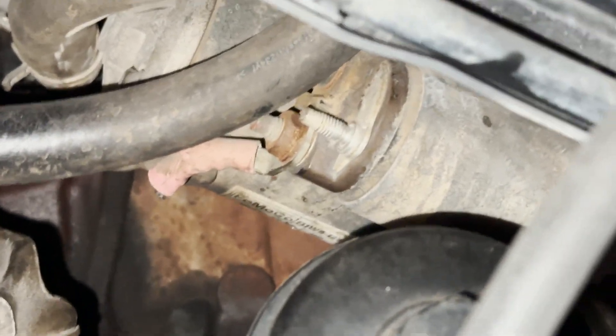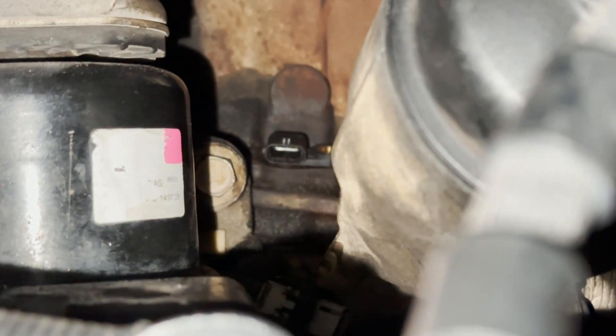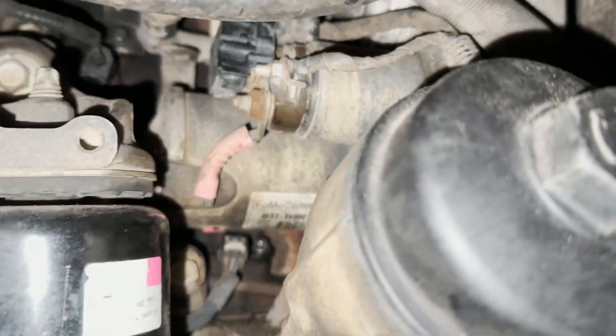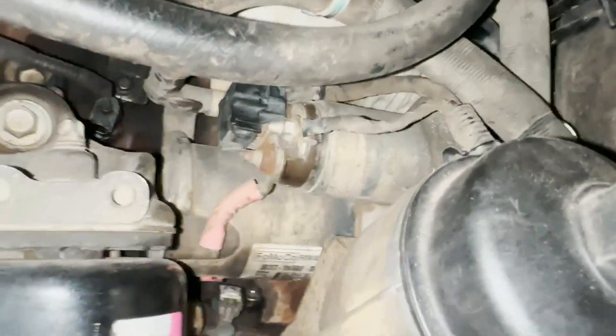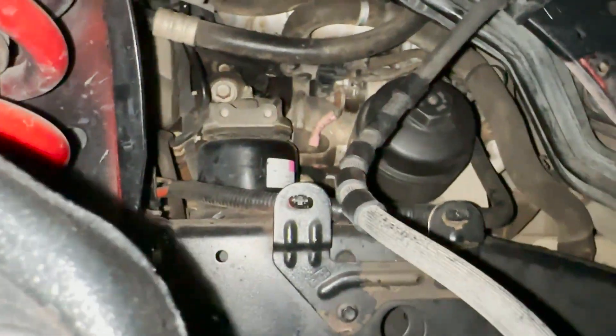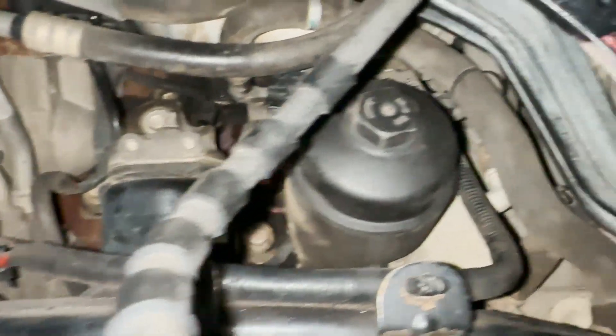I'll insert the bolt, connect the connector, insert the starter back, and put everything back where it belongs. Just like that, folks — you can see the connector is already installed, the starter is already back in place, and all the wiring is also in place. I can now go ahead, start up the vehicle, check for errors, and make sure everything looks good. Just like that we managed to sort out the issue with this Ford Raptor. I hope you guys enjoyed the video — please leave a like, comment, subscribe, and see you around. Cheers!